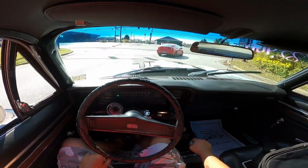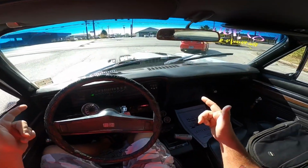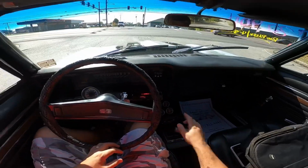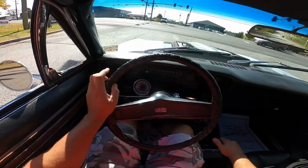And we're getting close to Maple Motors now, which is where I'm gonna be picking out the flaws. We've got good engine temperature sitting right above 180. Oil pressure's right below 50. All the gauges are working down there on the floor. Our speedometer is not working on the dash. The tach there is not working.